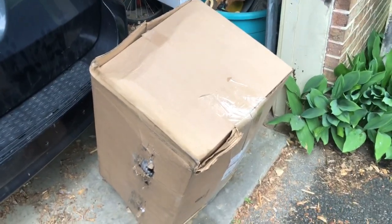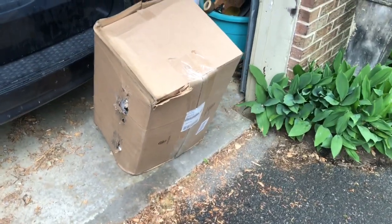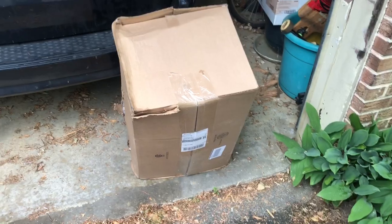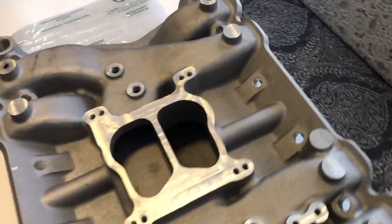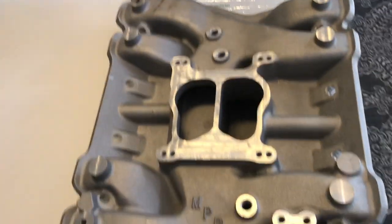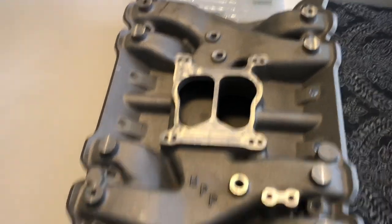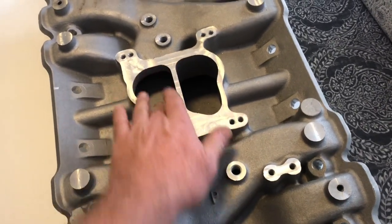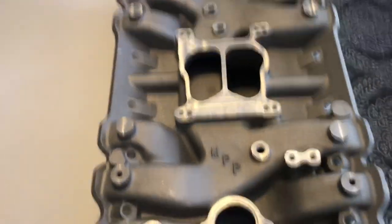This is my aluminum intake that's going to block off my exhaust passageways to keep my fuel from boiling and hopefully allow me to keep the ignition timing advanced a little more. We've got no exhaust going across the thing, so we're going to go with either a manual choke or maybe an electric choke. I'll find out whether I need to chamfer it for the secondaries to clear.